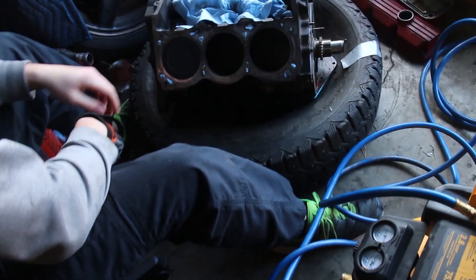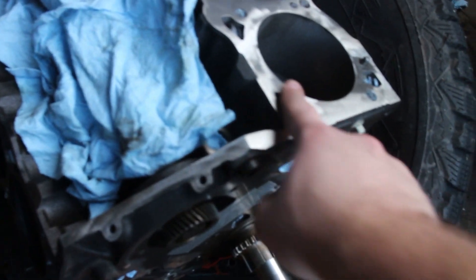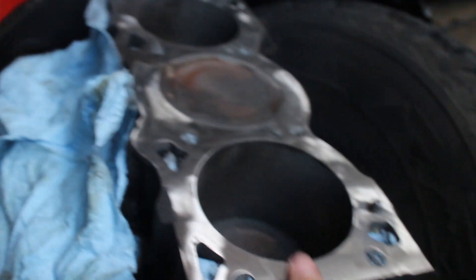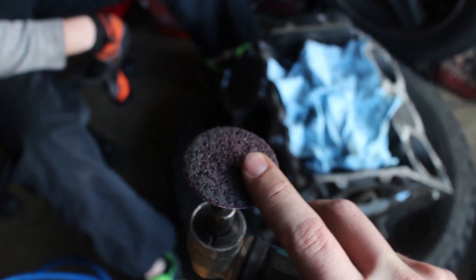Isaiah is here. He's resurfacing the block for the cylinder heads from the Bonneville. They're doing a pretty good job. It's kind of hard to pick up on camera how nice it looks, but it's definitely smooth to the touch. We're just using a grinding wheel and a Scotch-Brite disc type material. Makes it really easy to do it gently and nice. Tristan has many friends that have done this before and run them, so it shouldn't be any problem.